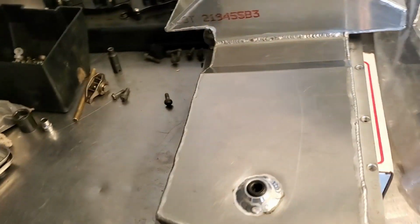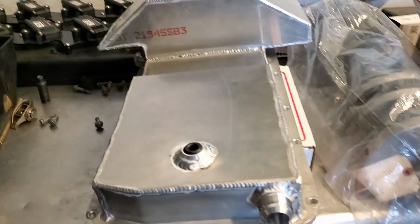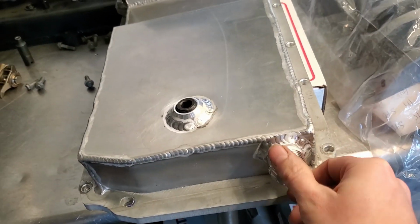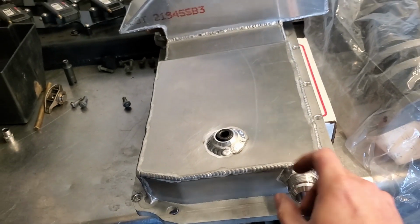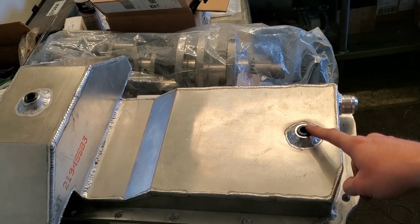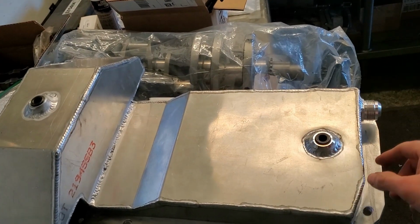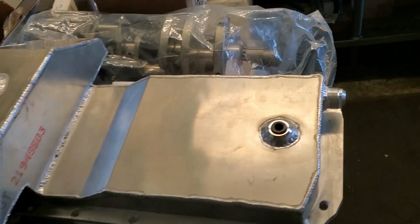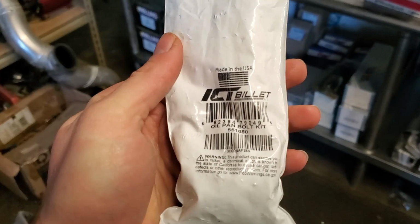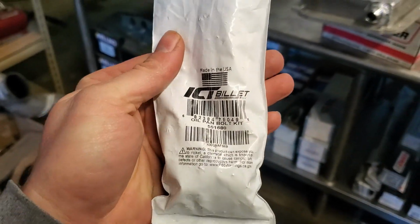But what I do want to show you is the pan came in, and the dash 16 bung for the oil return has been placed on it. I have a front oil drain as well as a rear oil drain on this now. So I'll throw this on, and also, I'm not sponsored by ICT. They just have pretty reasonable parts.